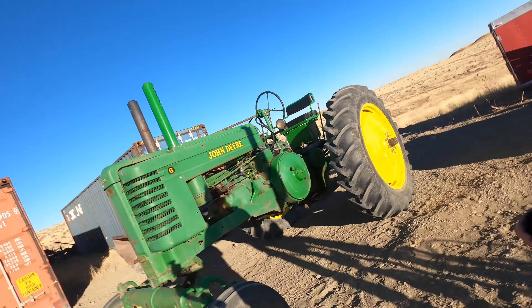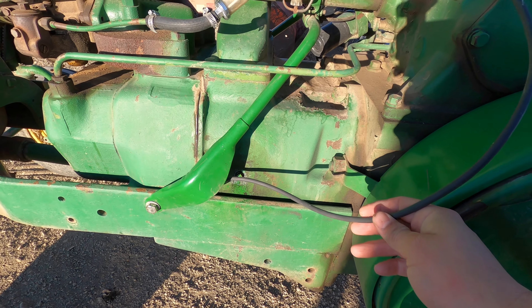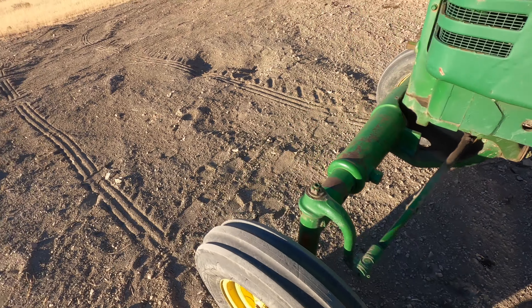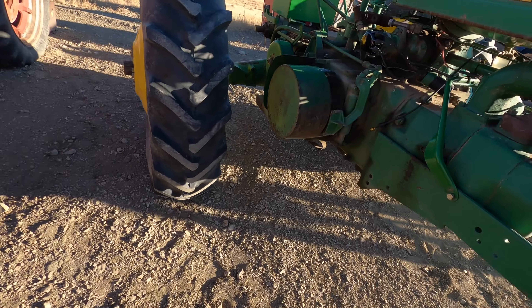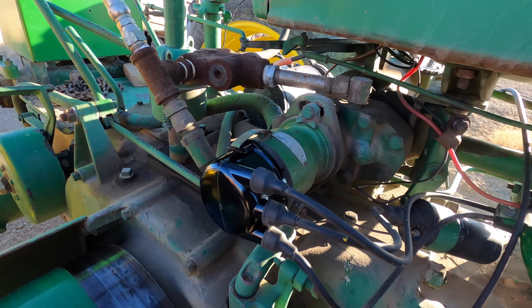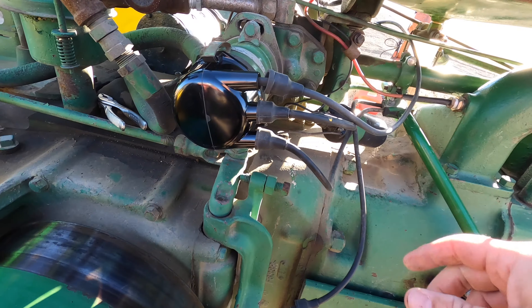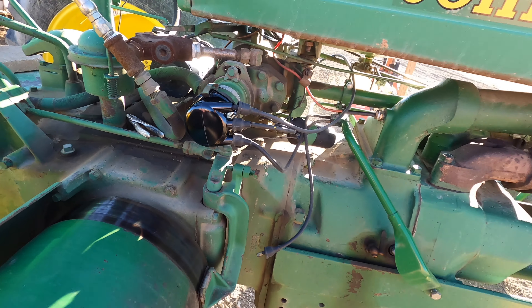It's still running the same, so let's change those wires out. Because we're troubleshooting and not just part-swapping, I hooked up my long plug wire, fed it through that side, and hooked that up to the distributor — just that single plug wire, because that's the one I was suspecting has an issue. I've got that temp wire put in there; I don't have the boot adjusted right but we're just going to start it up and see what happens.